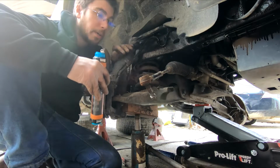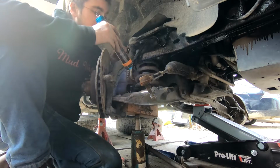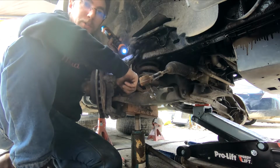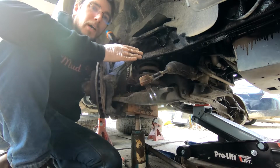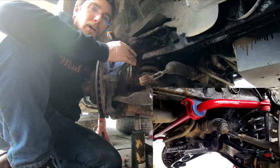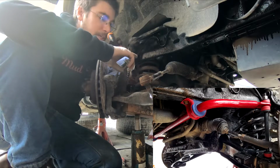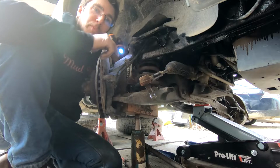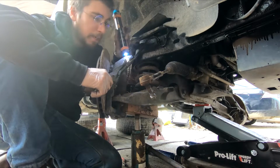All right, the next thing you're going to need to do is take out your sway bar link, which sits right about here. As you can see, mine is gone. That's because I actually took out my entire sway bar all the way across, because I'm replacing the upper bushings and I'm replacing the sway bar links. I can include those parts also in the description of this video.